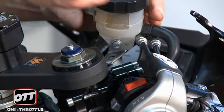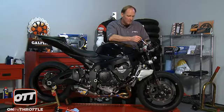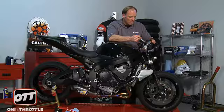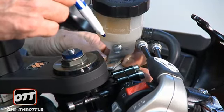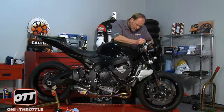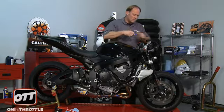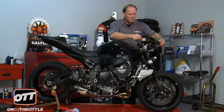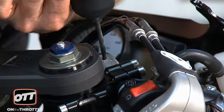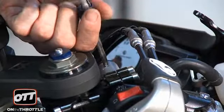What we've got is our reservoir coming over the MotionPro revolver throttle lines - we've got plenty of space there. The reservoir clamp, which was made from the stock piece, I went ahead and bent it in a different angle and trimmed a small amount off. It sits perfectly with no stress on top of the clip-on. Just let it sit where it wants to - if you try and push it at an angle or put it in a different place, you can see that the MotionPro cables flex a little bit as you move it around. Take your marker pen, put a nice fat mark, and then check your work. Move the reservoir out of the way, use an extremely small bit and drill the first pilot hole, then drill again with a second drill just slightly smaller than the bolt itself, then use the correct tap to thread the bar.